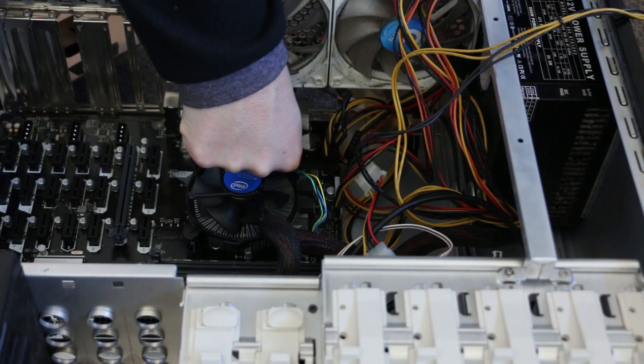Just a quick word about the RAM. What we're doing is installing one stick of RAM. That's not recommended — it's recommended you always insert two sticks so it can use dual-channel. This will make it about 10 to 15% slower. This is an 8-gigabyte stick and we're building on a budget, so we'll try it with 8 first and then we can buy the other one.